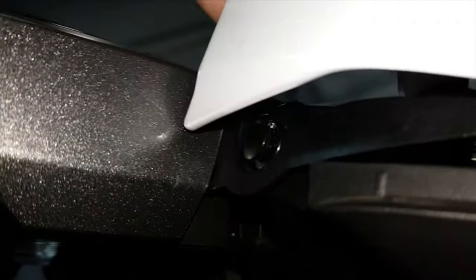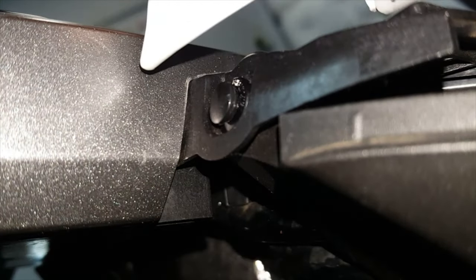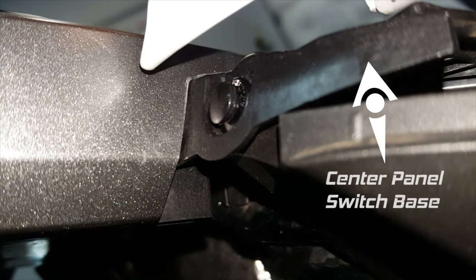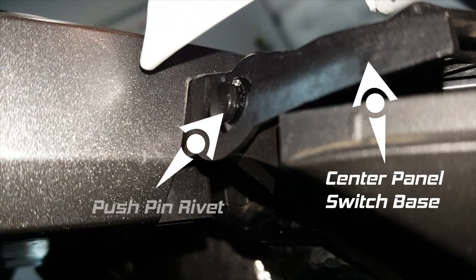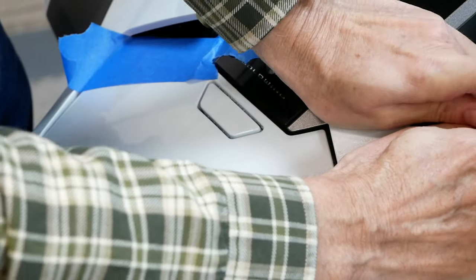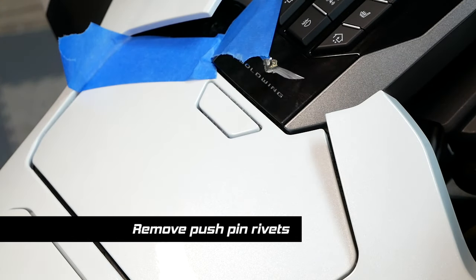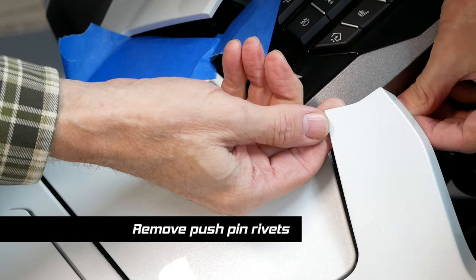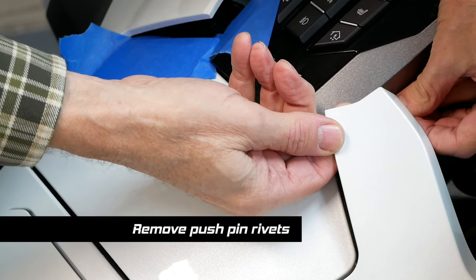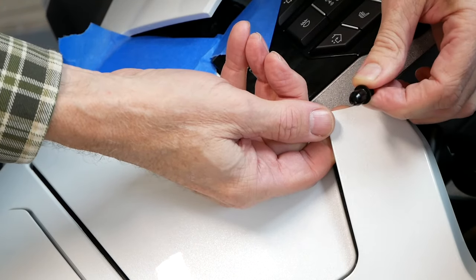Now I'm going to move the camera around where you can see the front edge of this base — this black plastic is actually the base of the center panel switch. You'll notice this little pushpin rivet on the front, and we have to remove that pushpin rivet first. You can usually get your fingernail underneath that little edge of that rivet and just pop it out. Now I'm going to go ahead and lift up the right side flap, like we did on the left side, before I pull out those rivets. By just pulling up on that flap a little bit, you can get access to that rivet using your fingernail. Then I'll do the exact same thing on the left side.